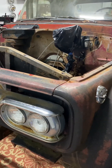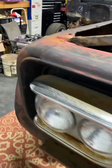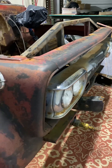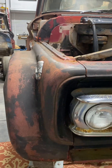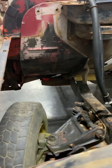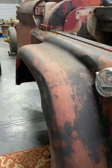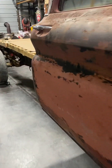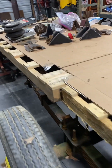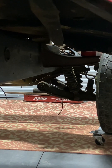I believe that's a wrap for the day. We've got the front sheet metal disassembled, inner fenders removed, outer fenders put back on, mounted back to the header panel. Decided to keep the grille inside — glad I did because I didn't want to pull those rusty bolts if I didn't have to. Overall I feel like our line is pretty close, but it's got some adjustments it needs. With the inner fenders out of the way, we can start leveling out our plane here to make sure that our cab and front sheet metal sits level. Our next path is pulling out these cab mounts, getting everything set up exactly how we want it, locked into place, and welded and bolted on. I've got it roughed in where the rear cab mounts will sit, the front cab mounts are pretty much in position, and I could do some adjustment of the overall body.